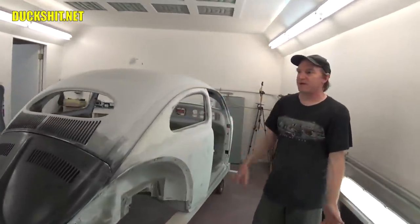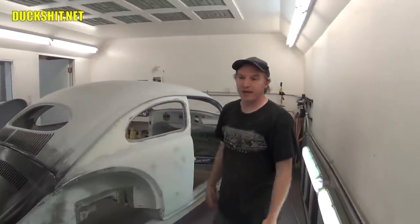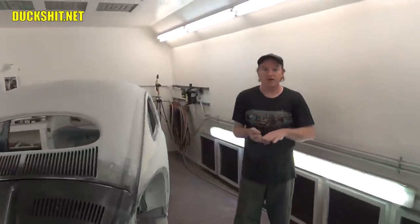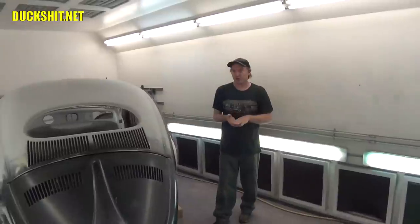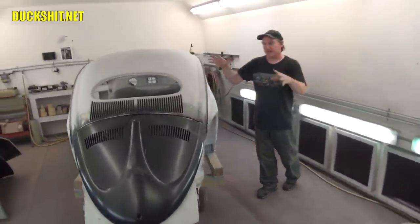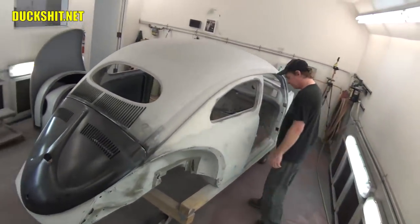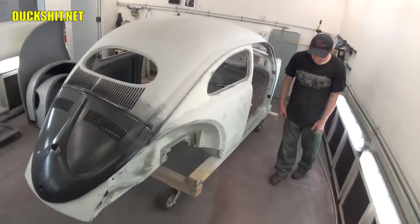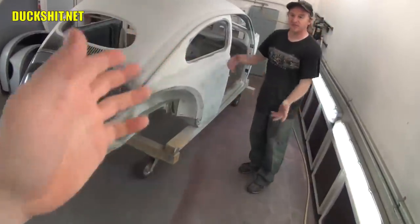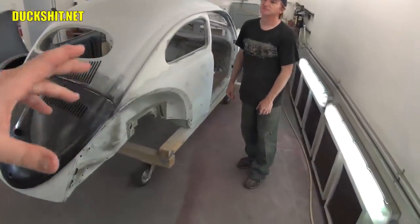The '57 Chevy that we have, that was bodywork a year ago. And we had videos up on that. And that car went through the paint process pretty well. The only delay was the weather, because our humidity was too high and we wanted to be in a certain parameter that he's going to show the car at, because all cars' bodywork at a certain temperature, they're going to be perfect in that range, because everything changes with temp and humidity. So the volume of the filler materials and anything else that you put on there can shrink or expand. It just does what it does, based on its evaporation of the volatiles and then the re-soaking of the humidity.